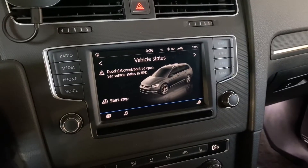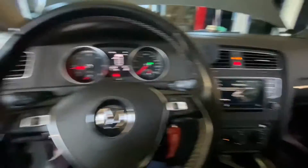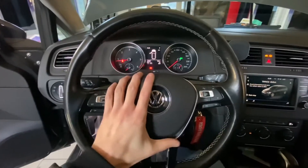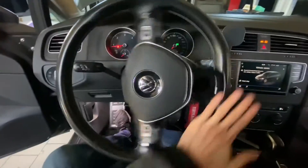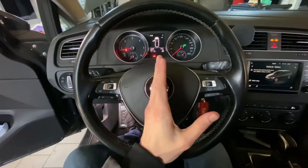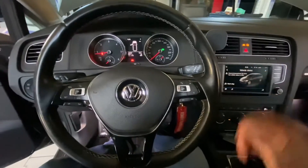No warnings about cruise control, stability systems, park systems, tire pressure monitoring, parking sensors, and so on. The reason you see all those errors is the steering wheel angle sensor, which needs basic settings. You don't need diagnostic tools like VCDS or OBD11 to perform the basic settings procedure for this sensor. All you need is to turn the wheel to the ends and back to center. Once the sensor knows the end positions of the steering rack, it knows exactly where center is and the current position - which is required for all those systems to work properly.